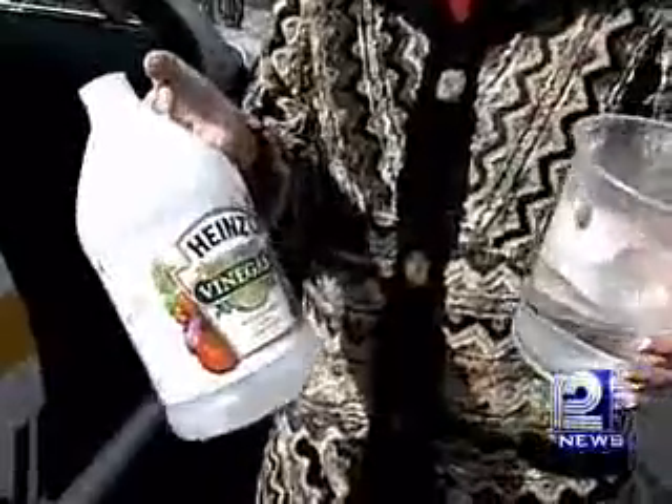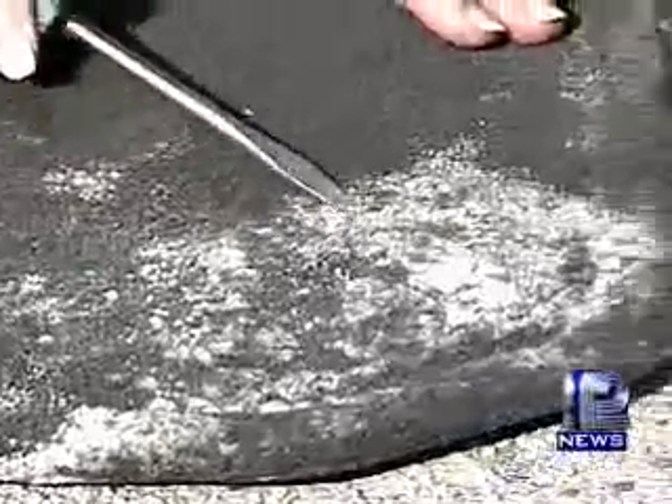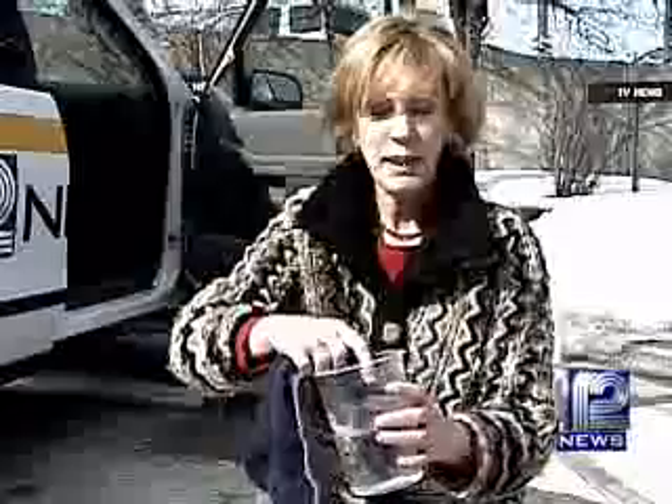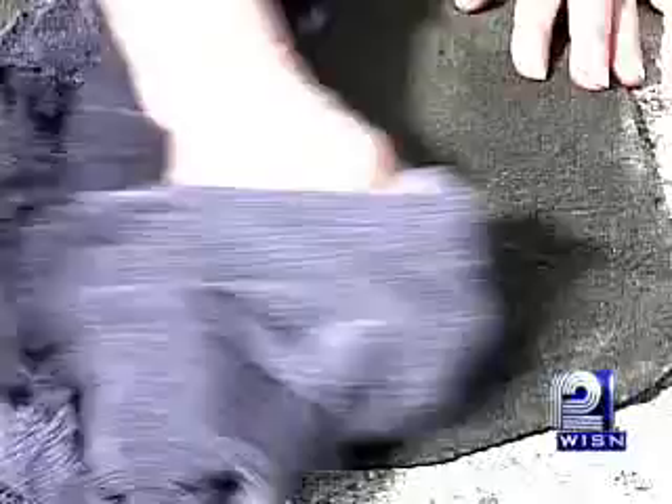Vacuuming is key. If you'd like to try a little at-home detailing to remove salt, grab a bottle of white vinegar, water, a spray bottle or bowl, and a few old towels. Make a solution of half white vinegar and half warm water. Gently scrape away excess road salt, then apply the solution to the carpets in your car to remove road salt and stains — it also works on the upholstery. It takes a little elbow grease, but it actually works pretty well. Be sure to blot dry and wait to put your mats back in until the treated carpet is completely dry.